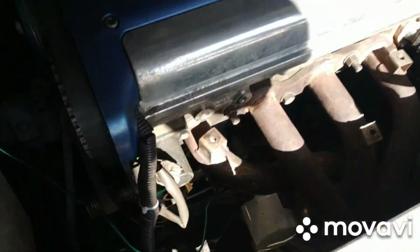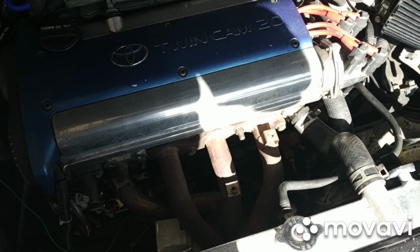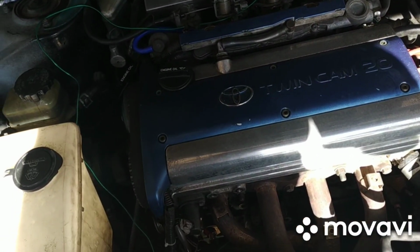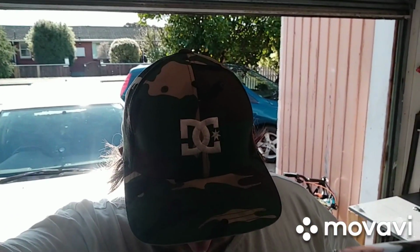So that works down from there, that little water jacket. But my problem is I think that it's reading a bit of exhaust temperature along with block temperature. So it says it's reading 120 degrees, but the factory one still says it's at normal operating temperature, unless I'm just getting a block temperature, because I suppose it's the last part of the block. That might be why it's reading a higher temperature. I suppose it'll go through that bit last before it goes back round and cycles back into the radiator. So maybe it hasn't crept any higher than 120.